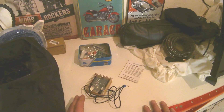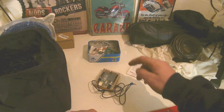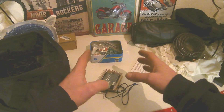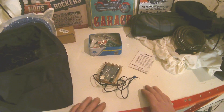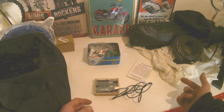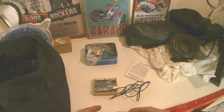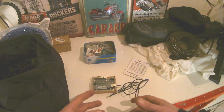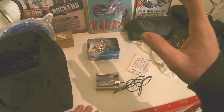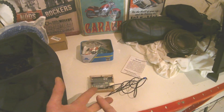The software I use works with this and another method, but I won't bog you down with loads of information. This is an RPM pickup sensor - basically all it does at the moment is pick up RPM. The wiring has one wire, the sensor gets a five-volt feed, and it sends a signal at five volts. It works out the math and calculations for the dyno - rotating mass, and all the math equations. That's good enough if you just want top speed, BHP figures, and torque figures.